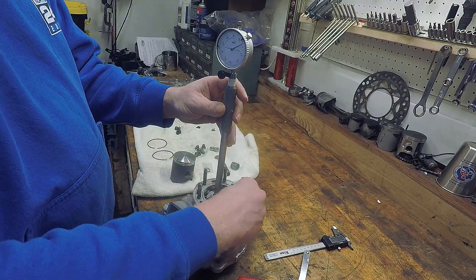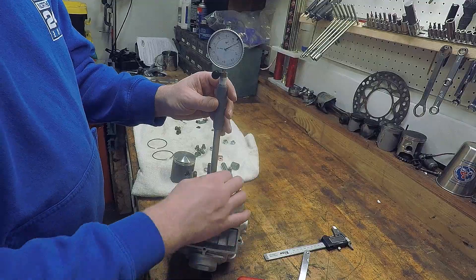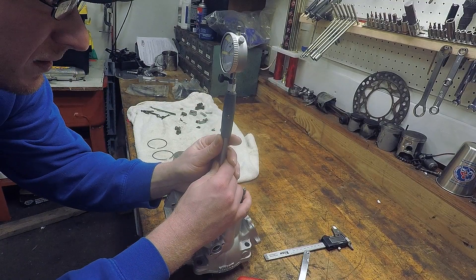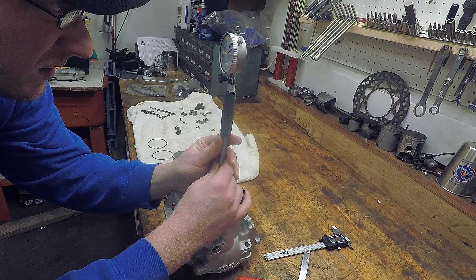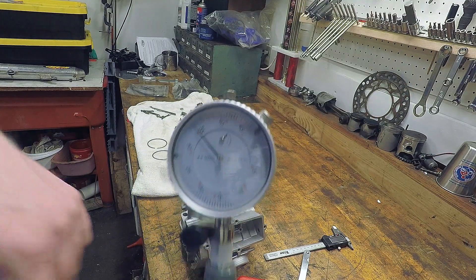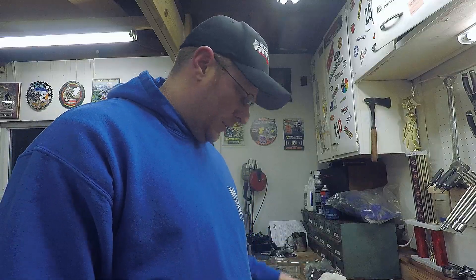This is set to zero at our piston size, so we put it in here and measure about half to three-quarters of an inch down. We're going from zero to this mark right here — one, two, three, four ticks — so we're at 0.002 inches. We're basically right within standard spec for a new piston. Max is 0.004 so we have two thousandths to work with. This piston is going to work perfectly in this cylinder.